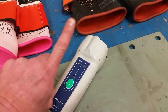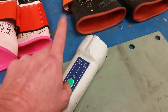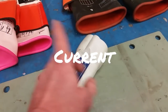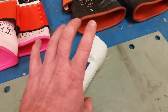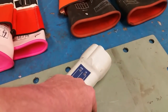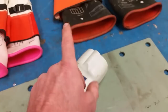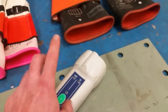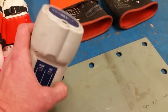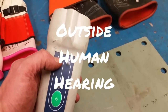When I talk about discharge — if you have a high voltage conductor bolted to a bushing and an insulator and it's tracking — a partial discharge is basically tracking. The electricity is trying to get to earth all the time, so you have to insulate it. If the insulation is compromised, it discharges and creates what's called a creepage path. For guys that work in EVs, I thought this sort of information and device may be useful.